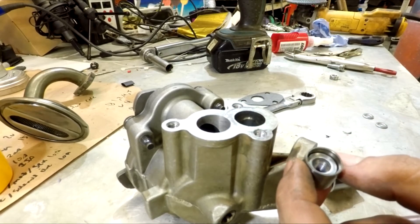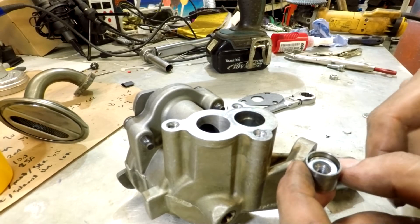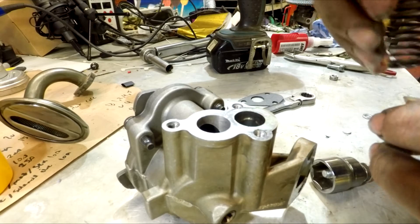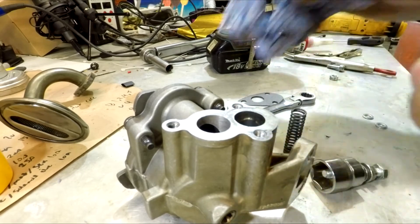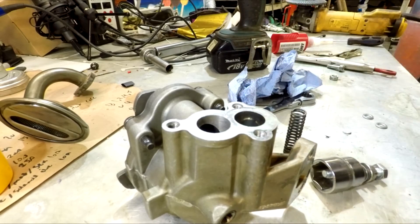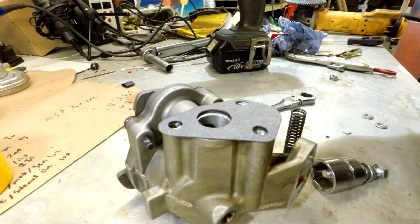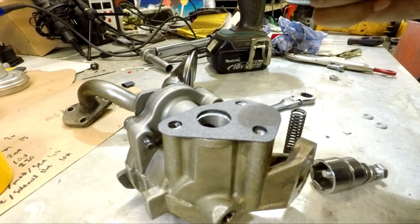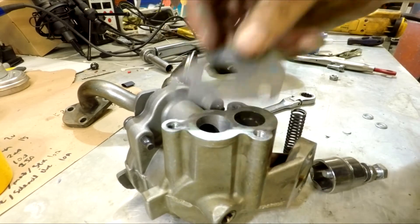Once you've ground your washers — I've gone for two washers here. It's a bit trial and error. I know you can find information online for the Pinto where they say use two washers, but for the 2.9 pumps there's nothing, so I'm going to try it and see what happens. It shouldn't make pressure too high, just a little bit of extra tension. Now if you have a Pinto or something with a seal plug, the hole you've previously made in it to remove it — you're going to have to weld it back up. It doesn't matter on the 2.9s because the gasket sits over that and the pickup also sits over it and clamps it down, so the plug can't come out and it's sealed. On a Pinto it doesn't overlap as far as I'm aware, so you'll have to seal that hole back up again.